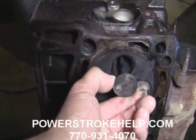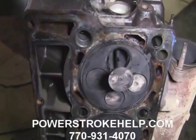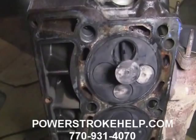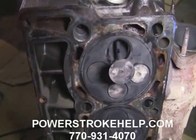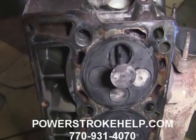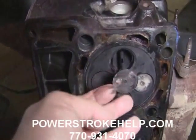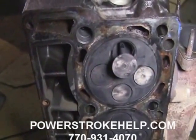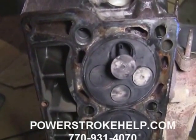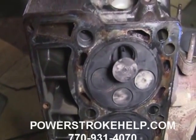We can't even pull this valve out because there's a lip worn into it at the top end. Valve guides don't work steel to steel — they figured that out way back in the 20s and 30s. Even Henry Ford's Model Ts and As were putting bronze guides in. Why did International choose to do this? They did it to cut costs, and unfortunately it shortens the life of the engine to about 200,000 miles, from what we're seeing.